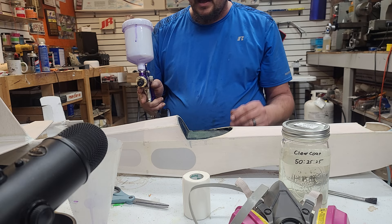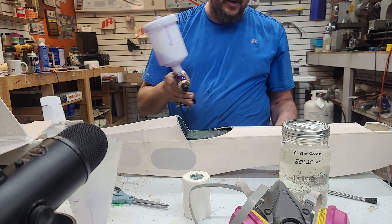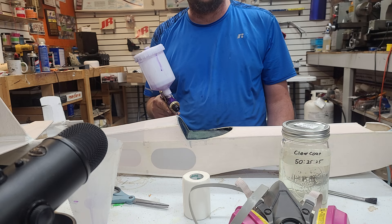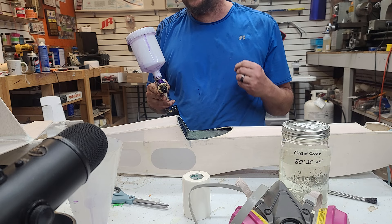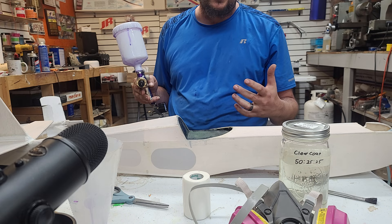A couple of things when you're shooting: I always get my edges first — like the leading edge of the vertical, the leading edge of the horizontal, the trailing edge of all those first. The trick is you set your distance, and once you start a stroke, follow it all the way through. Don't stop. If you stop, you could develop a run. In this butyrate situation it typically evaporates to where you really don't see it, but when you go to shoot your color you'll really see it — at that place where the run is, it's going to be thicker and leave a shiny spot.